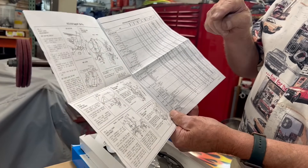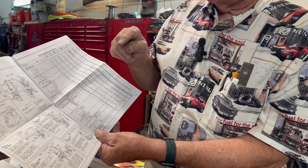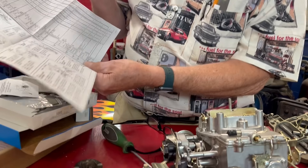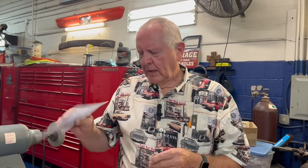I didn't want to go into all the specs because I wanted you to understand how to make your decisions about what you think is causing your car to run bad. If it's related to the carburetor — if it's smoking out the tailpipe with black smoke and idling rough — then you probably have a problem with one of the things I just talked about. I hope this is helpful. I'm Barry Wilson with Wilson Auto Repair. You can go to my website wilsonauto.com to see a lot of videos I've done to try to be helpful to you. If you need help, you can go on my website and phone me up and spend 90 bucks and I'll spend some time with you on the phone.